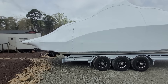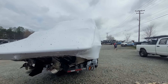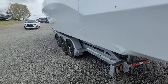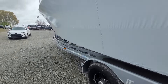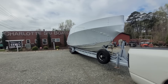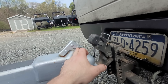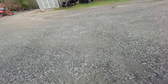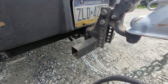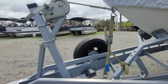Two and five-sixteenths — I'm assuming. There she is — big boat, 14,000 pounds, no damage, brand new. Let's get the tires aired up and back under. We are all hooked up to the trailer. Doing my once-over — we have some dilemmas. One, this was a fight to get a bolt for the pin because it wouldn't fit. And the breakaway doesn't work — he said they've been driving it like that. I'll check the trailer brakes before we leave. Basically these two points are what hold it, and we're going about 2,500 miles.